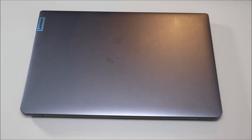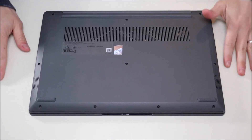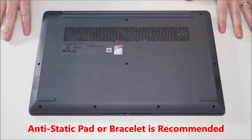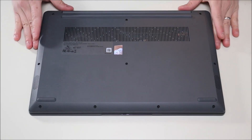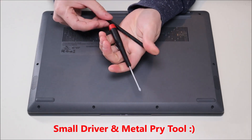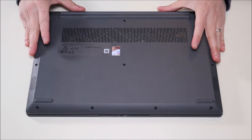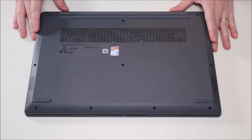First thing I'm going to do is shut it off, make sure that power is out, unplug the charger, flip it over, and I'll show you how to get inside. So first thing to do, we'll flip over our laptop and make sure that it's completely turned off. Also, my laptop is sitting on top of an anti-static pad. You're going to want either an anti-static pad or an anti-static bracelet to protect the computer and its components from any sort of damage. In addition to the anti-static gear, you're going to want a small screwdriver as well as a plastic pry tool. Check out the link above — it'll be a link to my Amazon store with some suggestions on equipment and tools you may need.